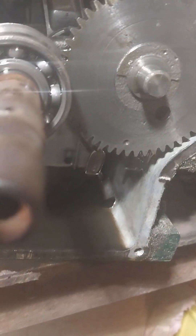I don't see any broken pieces down in there. The governor - I'll pull that off. I guess we'll have to disassemble it and mic everything - the length, width, tolerances and all that - see exactly what we've got going on here. The dipper is the same kind of dipper. Wondering why that other one didn't have the bearing. I don't even think it had the governor arm.